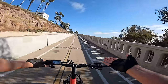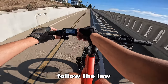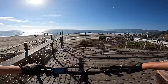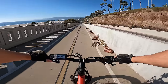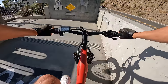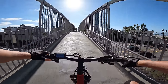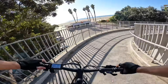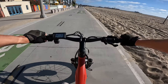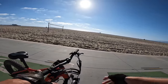I did not see anywhere in the user manual how to unlock the top speed to make it go faster — if you know how to tinker with a G51 display you could probably unlock all that. Battery is showing 45.1 volts under voltage sag at the top of the California Incline under full throttle. These Star Union brakes are new to me — the brakes feel nice; they are hydraulic with 180-millimeter rotors and they bring the bike to a stop. The levers are a little bit pointy — I prefer a thicker grip personally — but honestly if you just got this bike and never tried any other brake levers, you'd probably be 100% cool with them.